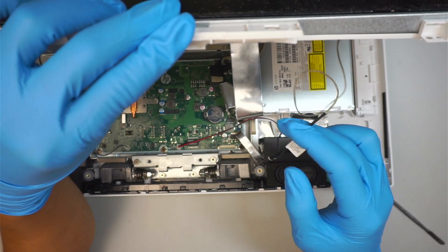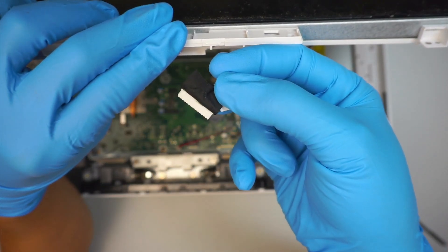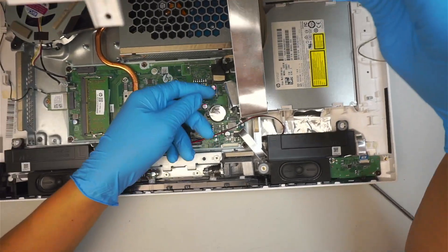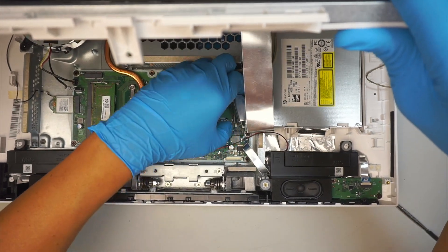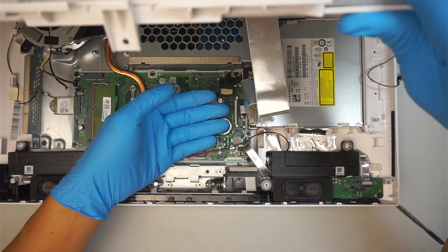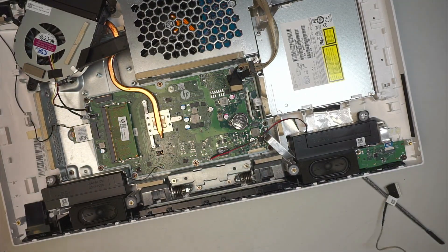So to install: the golden plate goes facing front, and the white connector side faces towards your body — that's how you install it. The next step is to remove the LCD cable. There is a little white clipper right here. You need to lift it straight up — it doesn't come off, so do not force it. Just lift it to disconnect the securing pin and make it loose, so that the flex cable on the screen can slide out. The rest of it then comes off entirely.